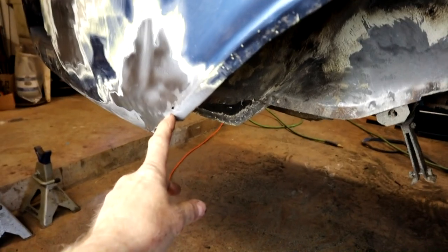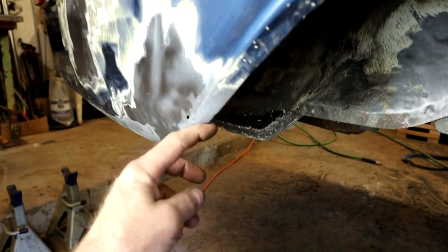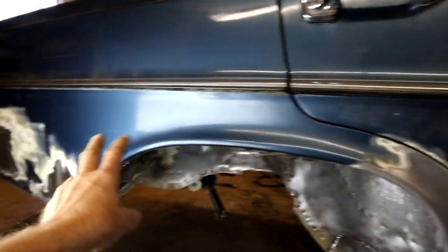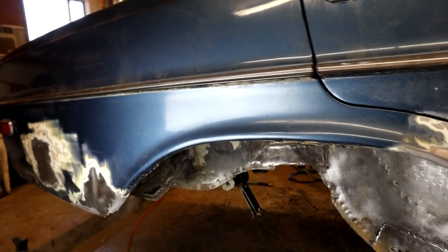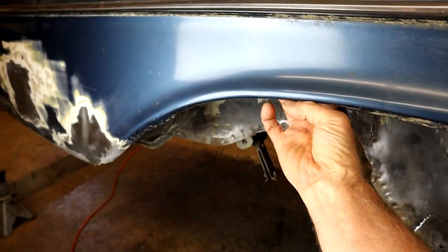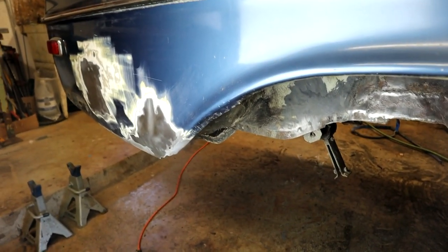This section is going to have to be removed — corroded here, and this is probably the worst external corrosion visible on the whole car on this side. There's a small hole and a missing lip, so all of that needs cutting out, the inner wheel arch attended to, and the section replaced. I may buy the repair sections from MB Classics, or cut that section off my spare 108 car — that also gives me an indicator of what's behind and lets me use original Mercedes metal. The trunk pans for both sides I already have new and ready to weld in.